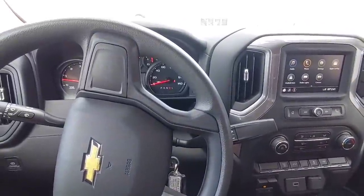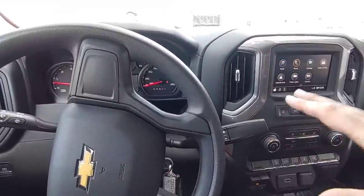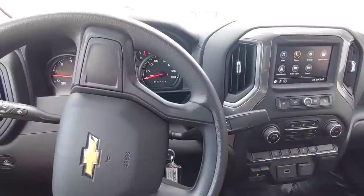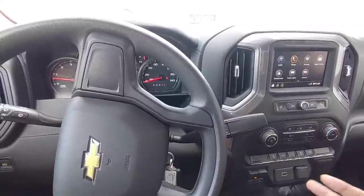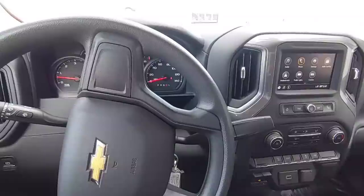And if the kingpin wasn't securely clamped into the fifth wheel hitch, it would have slid off the back and just rested on the landing gear that was down. But that's essentially it. That's a really quick way to do a tug test, just to be sure that you're coupled properly and you don't have the chance of your kingpin sliding out of your fifth wheel connection.